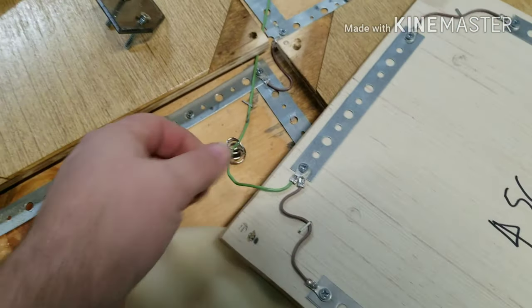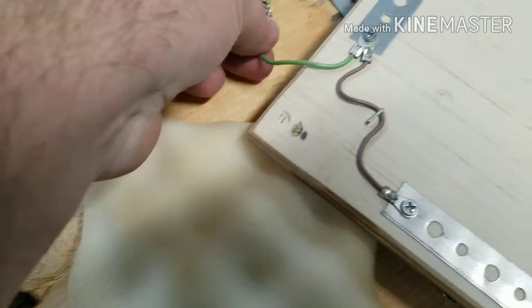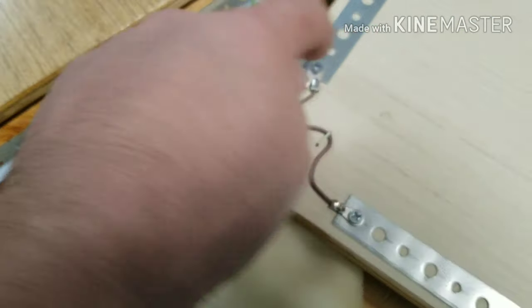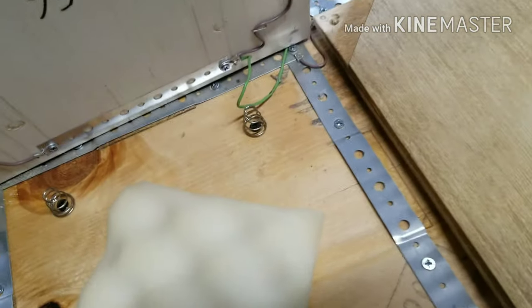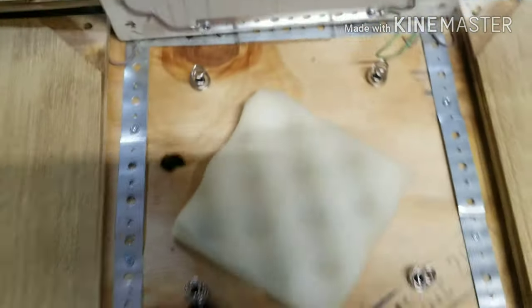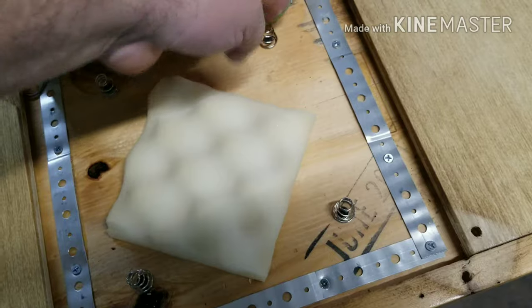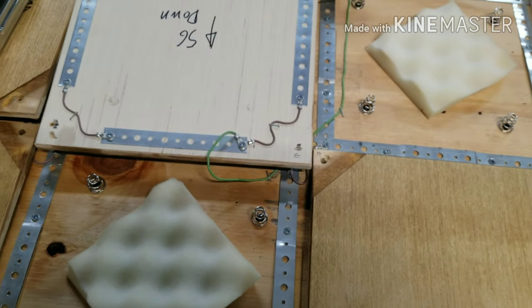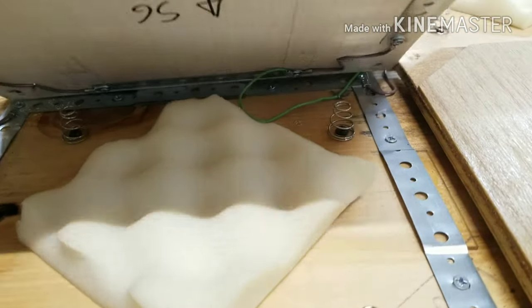The other thing is we don't want the wire to go into the spring — that's bad. When it squishes down it's gonna chop your wire. So I might readjust this so the wire hangs off the other side. When we flip it over, make sure the wire does not get inside that spring. I'll pull that spring out and move it over a bit — they're spread out to each corner but don't have to be perfectly in the corner. That will keep the spring from cutting the wire. Got my wire moved and oriented — looking in there, that looks pretty decent. Not gonna hit the wires; I moved the spring over a bit.